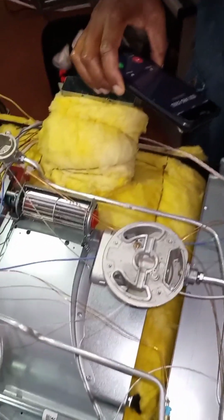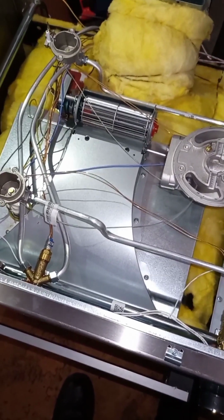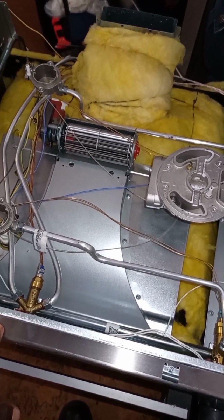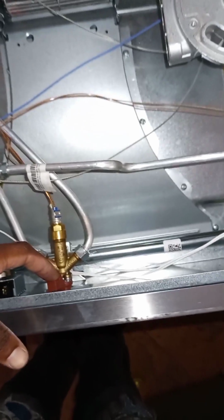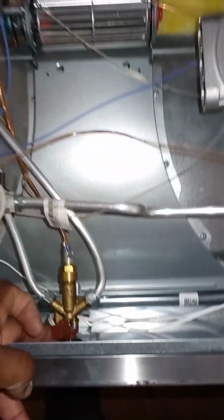for flame detecting. So when it detects flame, it opens for the gas. When there is no flame, it cuts the gas when you release the knob. So when they are not fitted properly, sometimes, always when you release the knob, it will cut the gas until it's fitted. When it's faulty, it will keep on cutting the gas when you release the knob. So that's how it works.